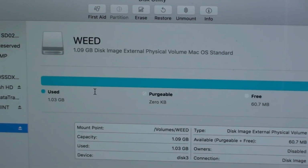Now, I don't have Catalina, so I can't test to see if this disk image could be opened on it. But I'm pretty sure it can, because if Sierra can modernize a disk image, then Catalina should be able to see that disk image with no problem. So if you have some old Macs that have Ethernet, even if they don't, you can probably figure something out. You gotta get that disk image over to something that can get on a modern system, then you can convert it with Disk Utility. And you can get out your files, and you can save these files on a modern system. And it's no problemo. So I'll probably go through and convert all these, and then I can transfer them, put them on some cloud storage, keep it safe. If I ever need to go into it to find anything, I got it all.